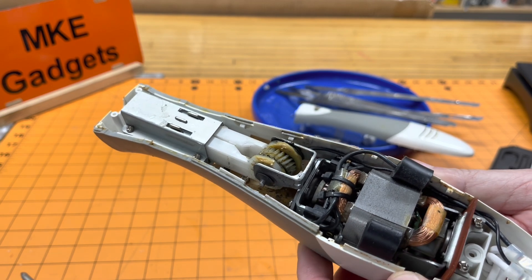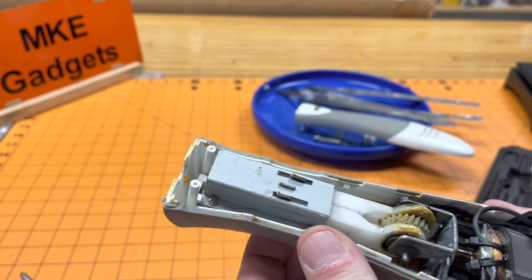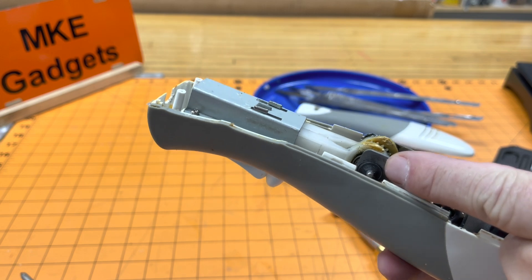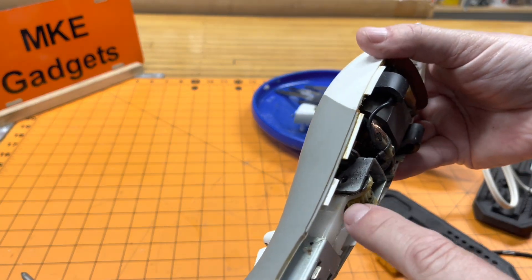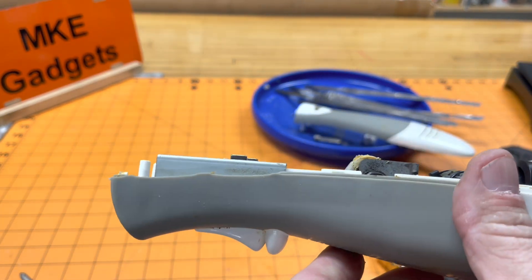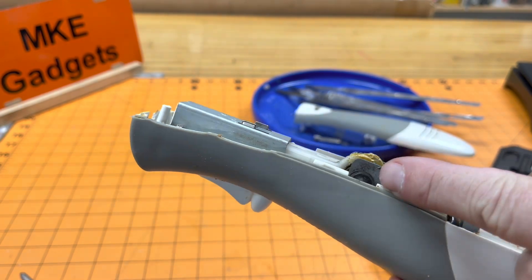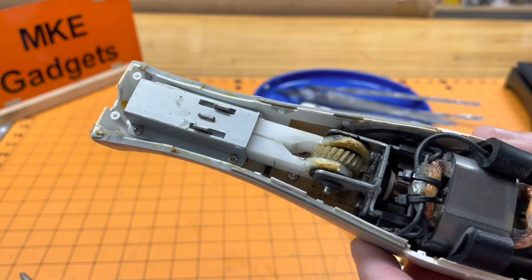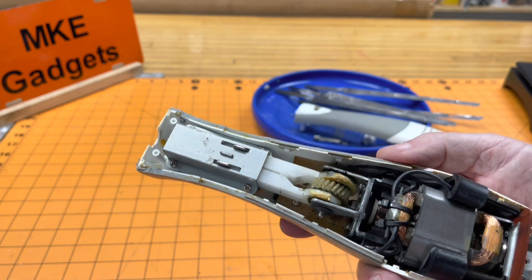Don't try this at home, but I plugged it in and let's see if it still works. I see what happened. The axle that this gear rides on — there's a clip on this side, and on this side it's missing. The axle came out. The client said this is about 20 years old, so that clip there is probably steel and it's probably stuck to the bottom of the motor. If I could find that clip I could put this all together, but the client already bought a new one. So let's start taking it apart and see if we can find that clip.